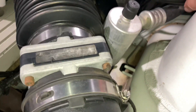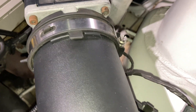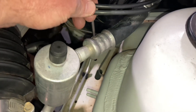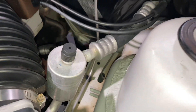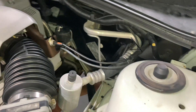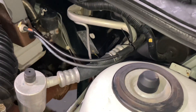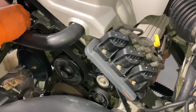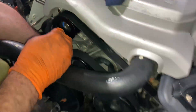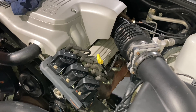We've still got to attend to this rubbing factor here with the throttle cable — a zip tie didn't work. It might be in a different position now, and we might have an even stiffer accelerator cable. We'll put some lube down it. We tightened up the engine mount from the top, and we've just got to do the four underneath nuts. We'll put it up soon and have a look at the height of the engine — it should be very different.